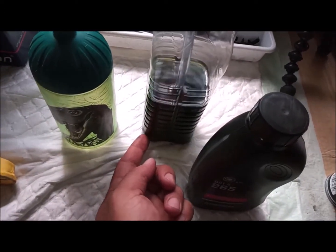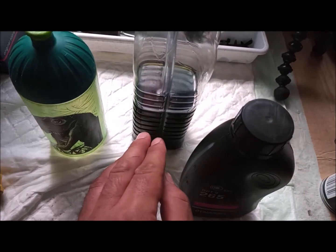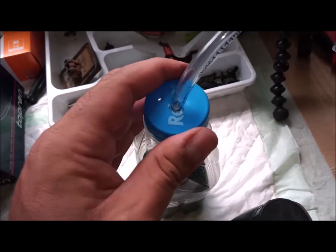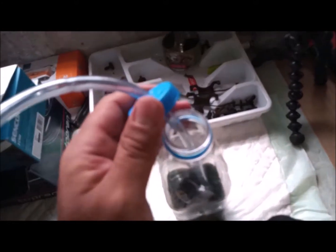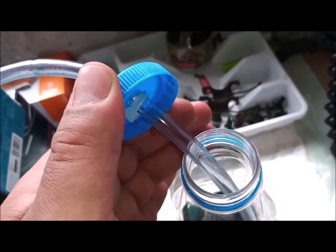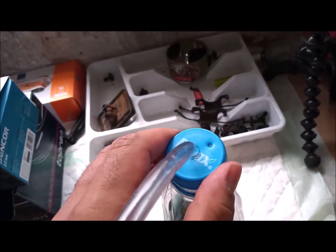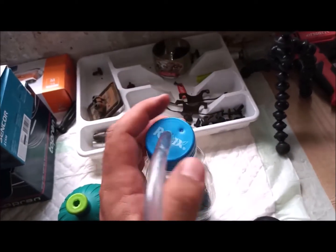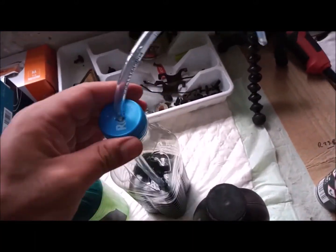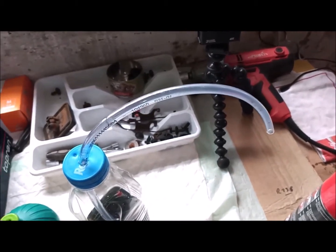The main important thing, as I said, is that you will really immerse the end of it from beneath, so that the end will be submerged in the fluid all the time, and we will make a ventilation opening here so the air will come out once the fluid gets inside this bottle. Inside you can add extra safety by putting the plastic tightener here. If you want to follow the measurements, the opening is 8 millimeters, and use this tube, it will be a very nice fit. And this is the most common fish tank tube used. After we close it, I will leave around 30 centimeters outside, so it will be enough for the tube to hook on the inlet of the bleeding screw, and I can rest the bottle on the ground normally.